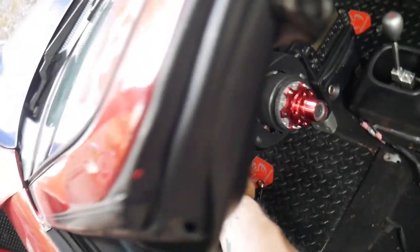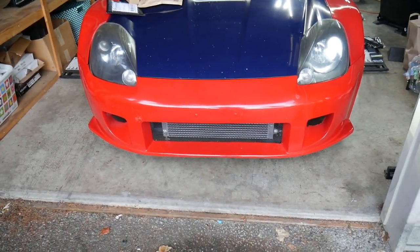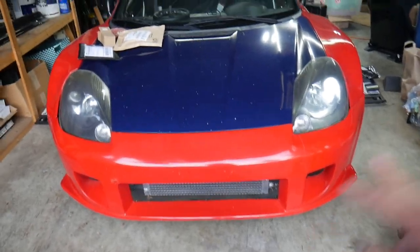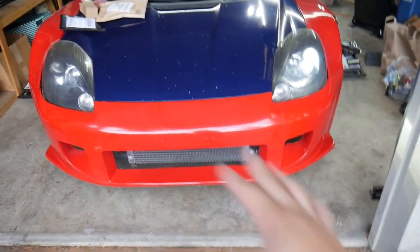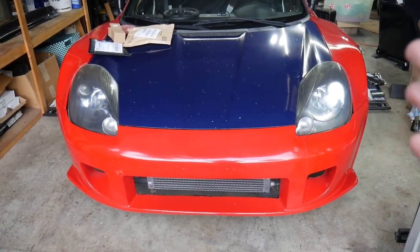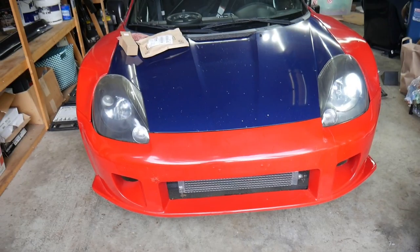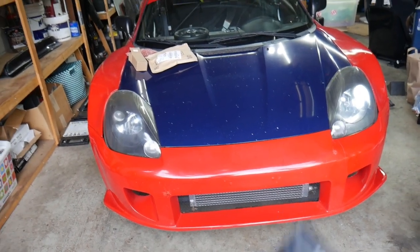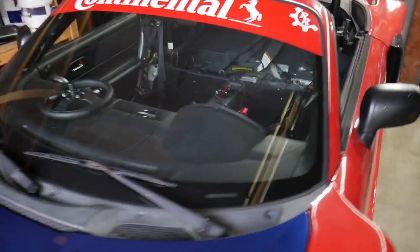The biggest thing with this car right now — only one of the headlights works. For the past couple years I've had these facelift headlights, custom blacked out. They used to both work but now one stopped. The bulb I believe is fine, but when you go from a pre-facelift car — 2000 to 2002 — and put on the facelift headlights, you need a conversion harness. I have a brand new one right here. I believe the wiring harness is the cause of my problem, so I'm gonna put this new harness in.